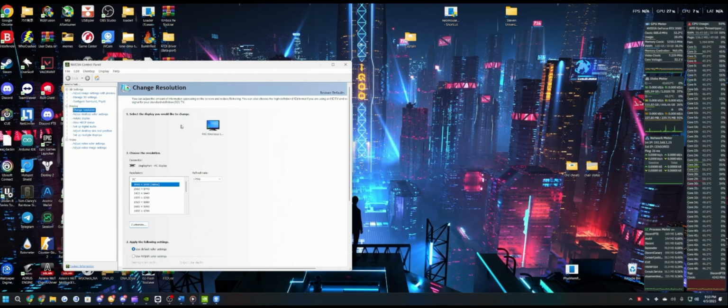If you have an NVIDIA GPU, I recommend going to the NVIDIA Control Panel to change the resolution and hertz from UHD to PC to then get your desired hertz. If you launch a game and the screen is black, it is probably because you are in full screen and have full screen settings that aren't compatible with the fuser. I recommend playing in borderless, as I find it all around just better. Or you can change the settings of your full screen to not get a black screen anymore.